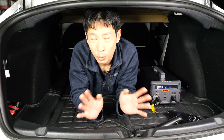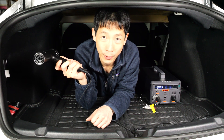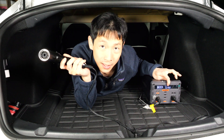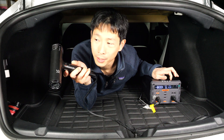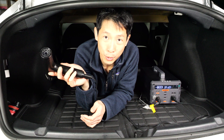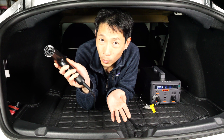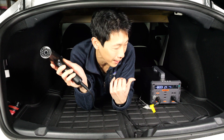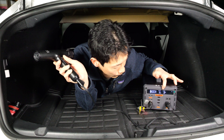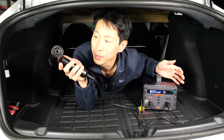Having an AC plug in a car is super convenient, especially if you're going camping. Typically you just have to let your hair dry, but in this instance you can turn on the AC — push and hold it, it says 60 hertz — and turn it right on. My hair dryer is actually from Japan at 100 volts, so if I turn it on maximum it consumes 1,400 watts, which is a little more than this unit can handle. If you go over, it just turns off, and then you can turn it back on and it'll self-reset.